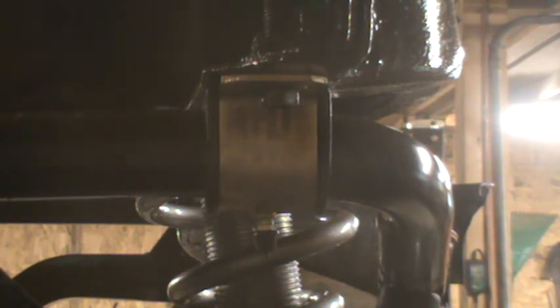Yeah, that won't move. I mean, it looks pretty darn close right there. And using the QA1, that looks like that's lined up with the center of the frame. And so that you know what I'm talking about, whenever I say we're using the QA1, it's marked QA1 on the sway bar, and it looks to be right in the center of the frame. So I don't know whether we got lucky or we're just good. We're good. We're not arguing with success.